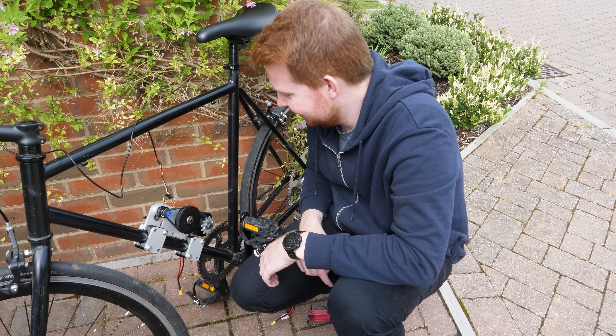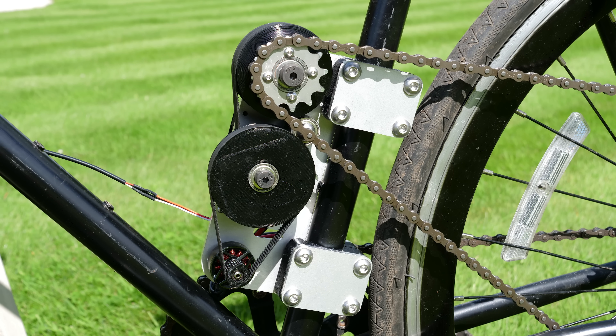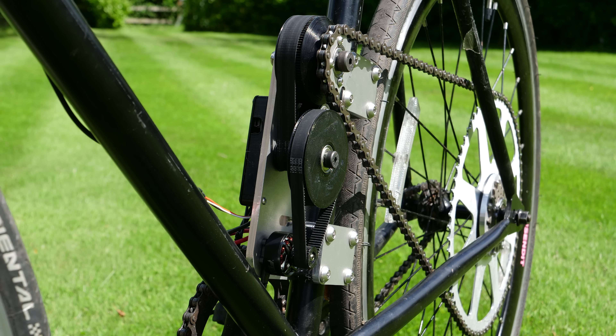So we obviously need a new motor with some more torque, but also one that will fit the current motor mount. I found this motor, which is also designed for drones and is only slightly larger than the previous motor. However, the difference is that it only spins to 15,000 RPM instead of 30,000 RPM. In theory, with half the max RPM, the motor should output double the torque for the same power. The 1,000 watt ratings on these motors are actually for the electrical power and not the actual physical output power, so the only way to find out is to give it a test. I also moved the motor and pulleys to a different part of the bike to shorten the chain, as well as stopping it from rubbing on the frame, which should hopefully reduce the chance of it coming off.